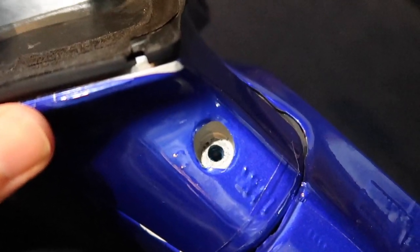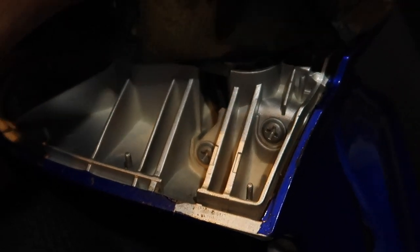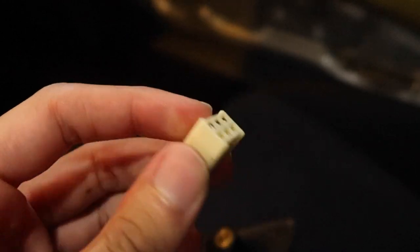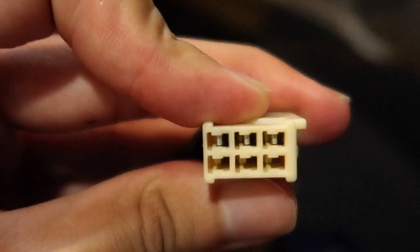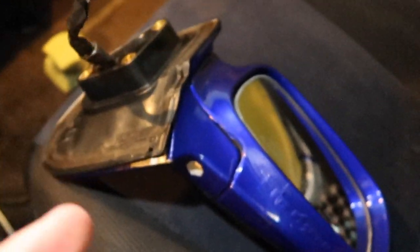If not, then this is just going to be the end of the video. To take apart the base you unscrew that — this screw is really, really tight. This is the passenger side mirror and I got it out. There's blue Loctite in there. The driver's side mirror — I stripped the screw, so I'm going to have to extract the bolt. And then after that you just peel back this rubber boot and there are two screws right there. That's it — just three screws holding it up. You are going to have to fish this harness through because this is the USDM one and we need the JDM one. And to do that I'm going to take out the pins just like I did with the wiring — you lift this up with a small pick, lift this thing up, go in there above the pins, you can see the white plastic tab, pull it up and then pull it out. Then I should fish through everything and switch the bases.